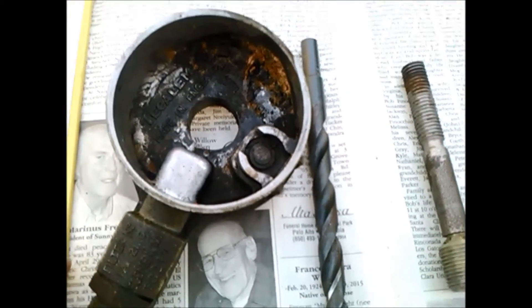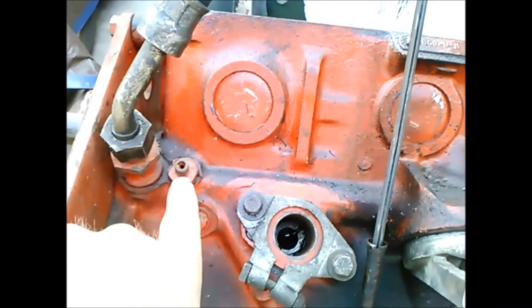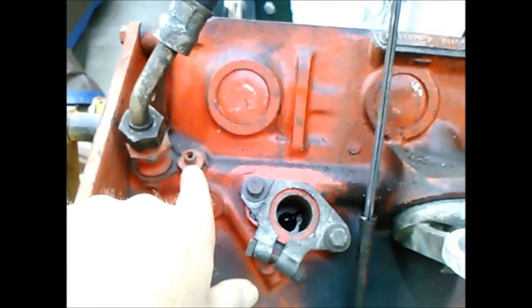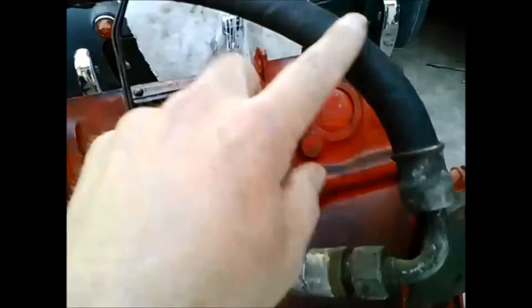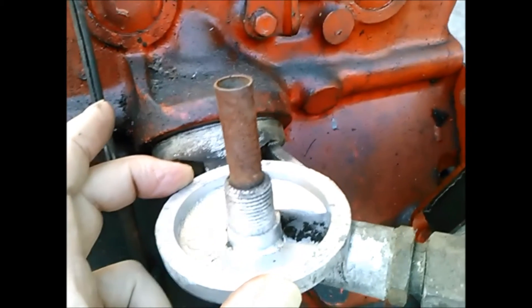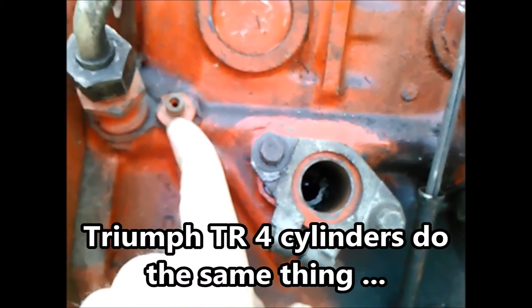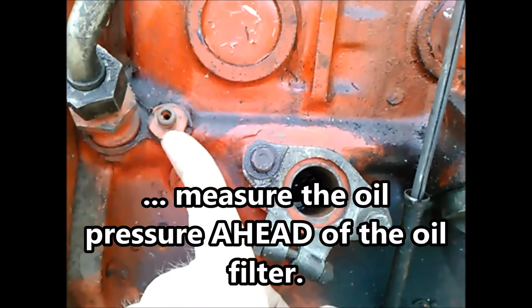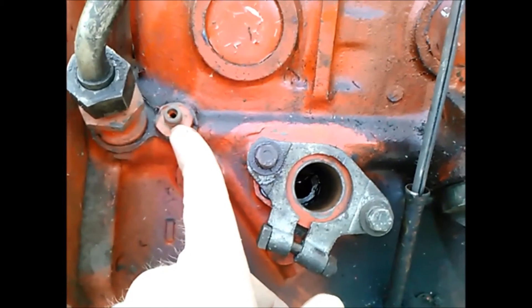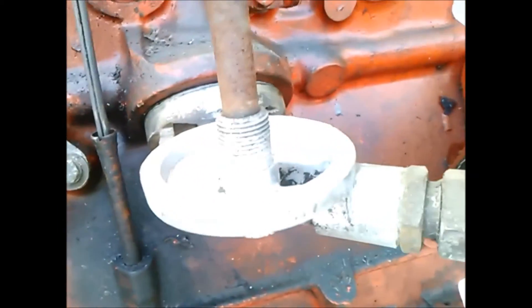As I'll illustrate in a moment, you cannot depend on the gauge reading to tell if your oil is being choked on the MGB. Here's where they measure the oil pressure — this is leading to either a gauge or a gauge sender. This is the oil pressure coming out of the pump, heading to the filter. So any restriction here — a plugged filter or excess restriction created by a spin-on adapter — is only going to raise the oil pressure reading at the dash. This is no way to monitor whether your clogged filter or spin-on adapter is restricting the oil flow, unless you interpret a high reading as meaning restriction downstream.